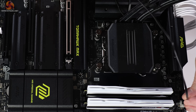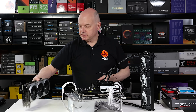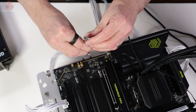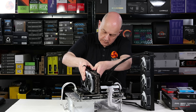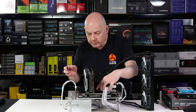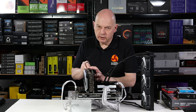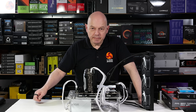We connect the pump of the AIO and a single daisy-chain cable for the fans. The graphics card is an MSI RTX 4090 Ventus 3X. To emphasise the easy build and dismantle features, pressing the release latch pops the graphics card straight out. It's a budget motherboard, but you get all the features you need. We connect power to the graphics card, and the PC is ready to test.